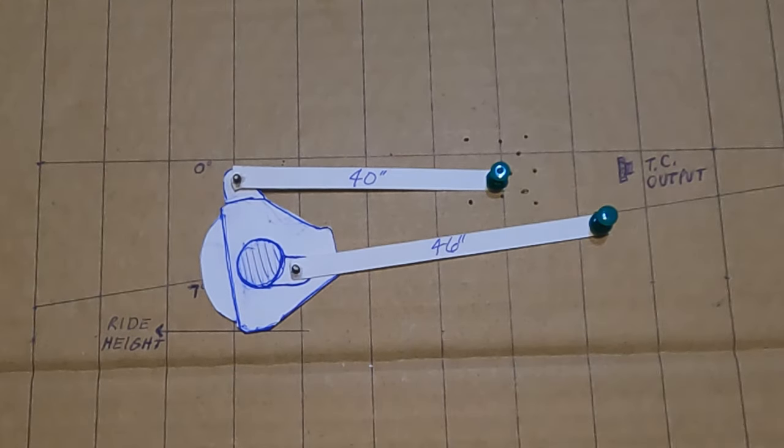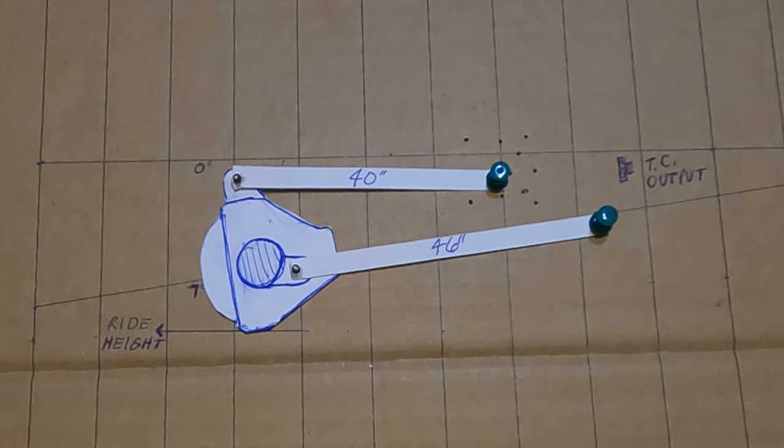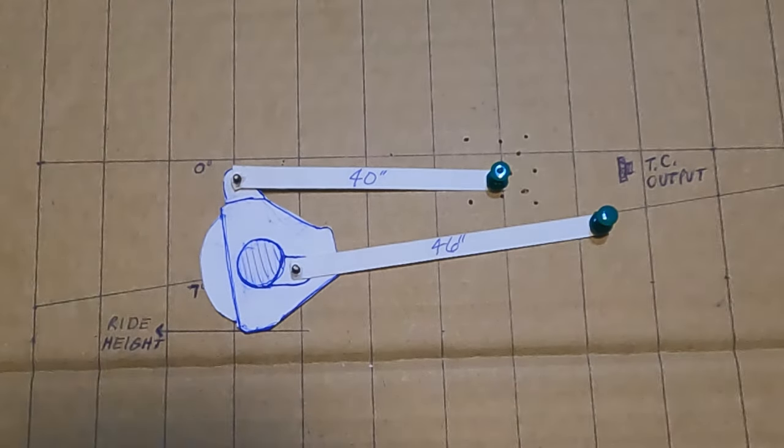So I think this is my favorite out of all the configurations. I build my four-links off a few basic rules that I follow, and they work fine. Make them adjustable if you can at the chassis — upper link mounts with four or five holes so you can play with the numbers on the trail. One ride try it here, next ride drop it one hole, drop it two holes, see how it climbs, see if it reduces bouncing. I'm more of a seat-of-the-pants guy — I don't like the four-link calculator, it's too complicated. This is for trail rigs and rock crawlers, not professional racers. Thanks for watching guys, I hope you learned something — over and out.